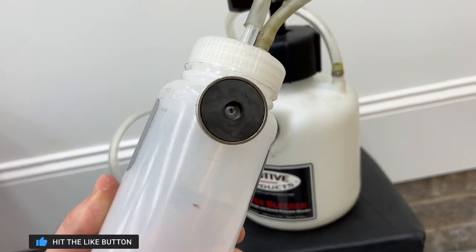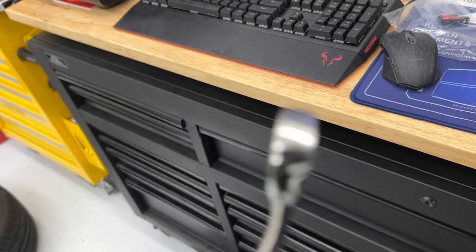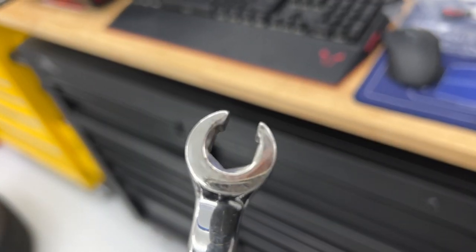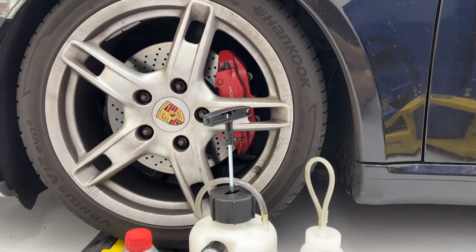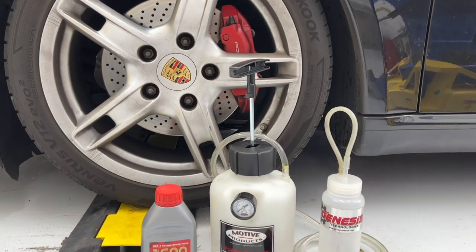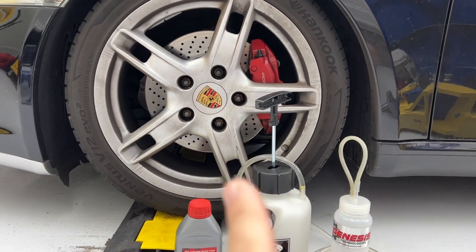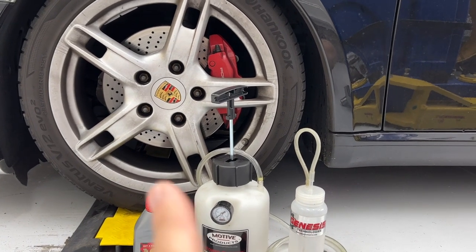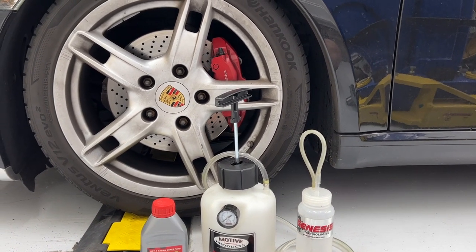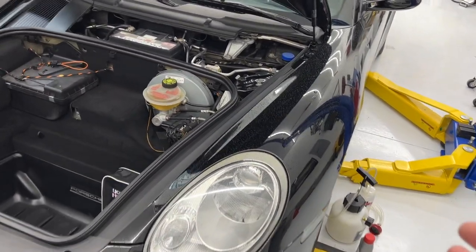This magnet is very cool. The only other tool we're going to need is an 11 millimeter crow foot wrench like this — you want one like this specifically, and I'll show you why in a minute. I'm going to show you every step you need to take so anybody can do it themselves. The first thing we're going to do is loosen the bolts with a breaker bar for your wheel, and then we're going to lift the car because we have to remove all four wheels.